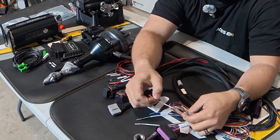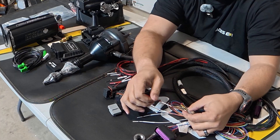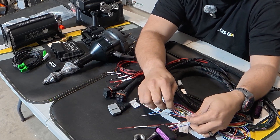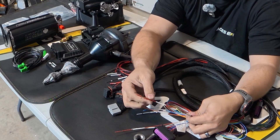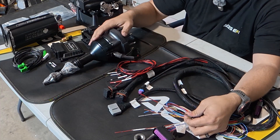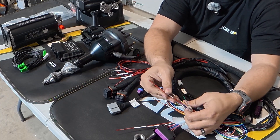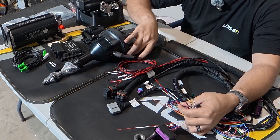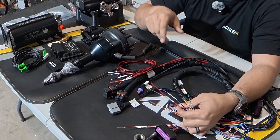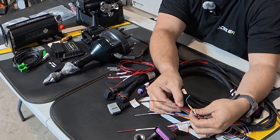There's a five-volt source voltage. We've got fuel level — this does work, you can wire the fuel level in. I believe ACES has a video on how to set that up, and I'll probably make one as well. Here is 12 volts out — the main thing I use this for is to control a relay or for the hall effect sensor. You take the 12-volt out and tach in, make a ground wire, and plug it directly into your hall effect distributor using a basic weatherpack connector from any parts store. But don't use anything major off this 12-volt out — that's not what it's designed for.